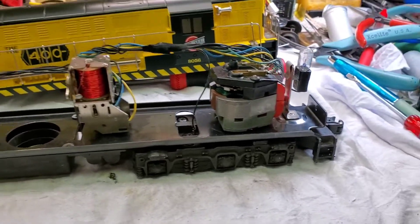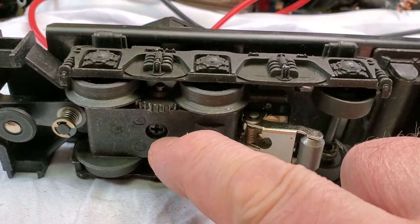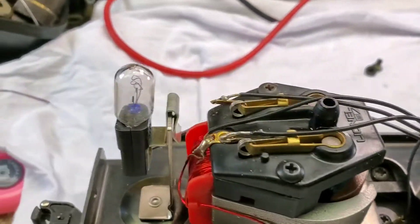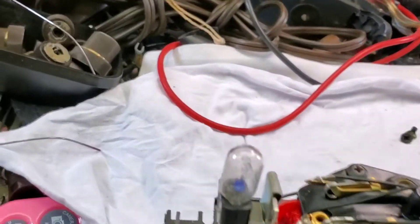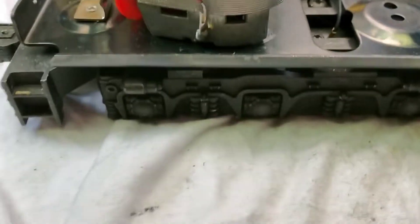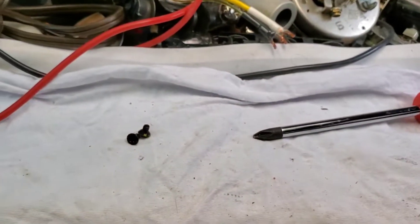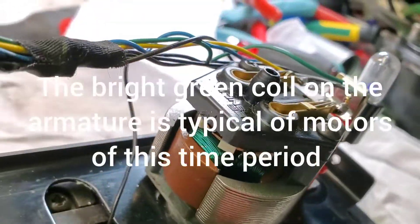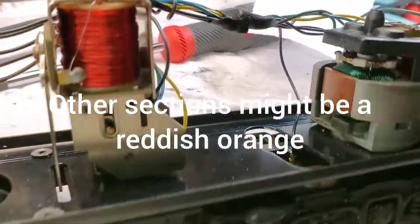I got it greased up. There's one screw underneath — take the motor off and there's a little tiny bearing in the bottom; you pump some grease in there. This is what I use for grease: a dental irrigator loaded up with synthetic grease. I did both motors of course, with drop oil on top and a little drop underneath the armature on the shaft.